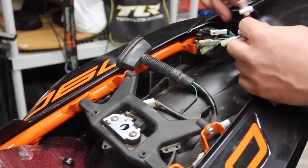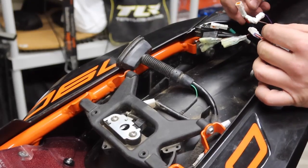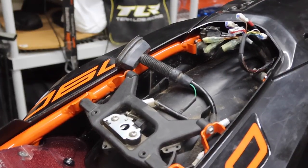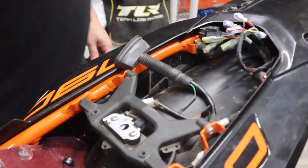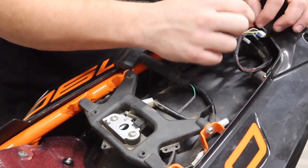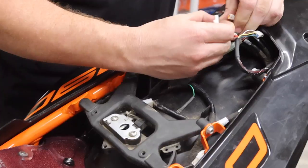And then, let's see here, these have red and green connectors on them, so I'm colorblind. I think this is red, but I'm not sure. So we're gonna go with that one first and we'll hook up this one second, like that. And I'm gonna walk around, check the ignition before we button all this stuff up and see if our turn signals work the correct way. And of course, I went with this is red or green and got it backwards. So colorblind strikes again. We're gonna swap these two wires. This is why we do this stuff before we button it all up.